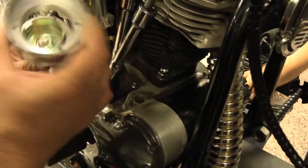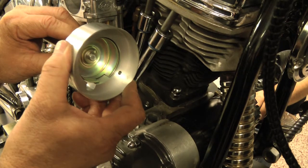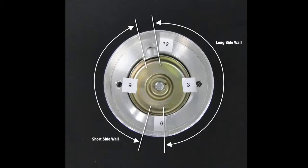If the housing is removed, you must place it back on the distributor base assembly with the locator pin and the small drilled hole aligned. Hold the distributor base with the aluminum module housing attached out in front of you and look down at the top so that you can see the gold anodized shutter wheel.